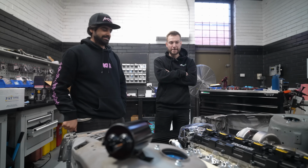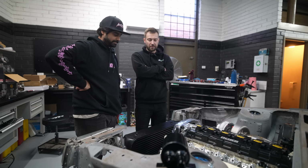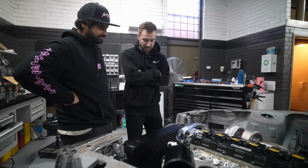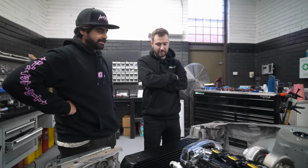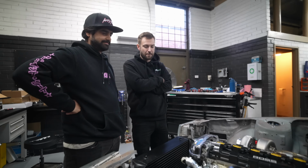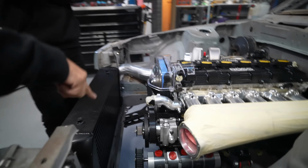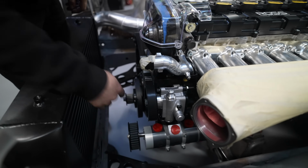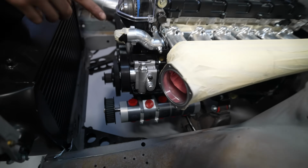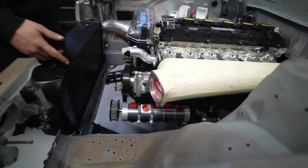There's going to be a bit of learning because you can kind of control the constant oil pressure, can't you? Yeah, well, you got a relief valve that you can adjust. It's come with some different springs, and then you've also got pulley size as well. And what's the go with this vacuum stuff? How do you fill the thing, and how do you empty the thing? Why is there a belt running the most important thing on the car? Yeah, well, I think it's a 4-stage pump, so it's got 4 scavenge, and then it's got the in and out pressure. There's 5 on there in total.